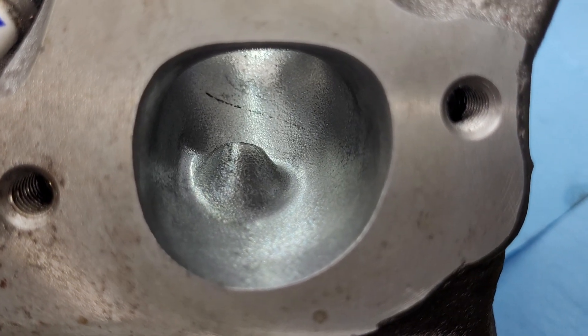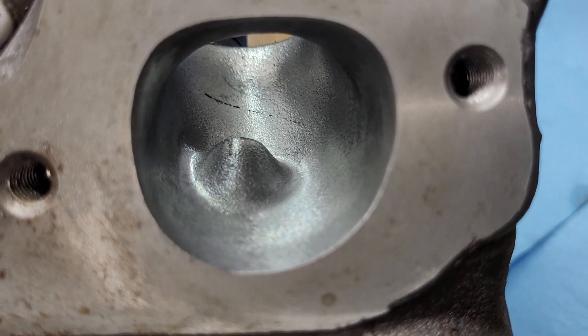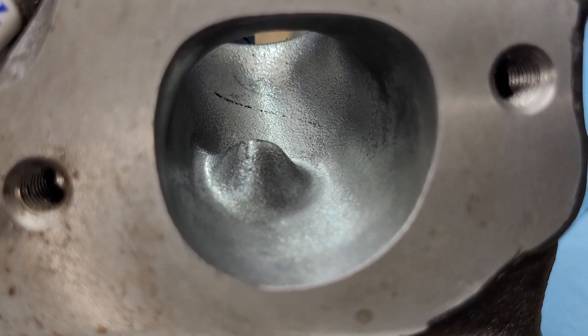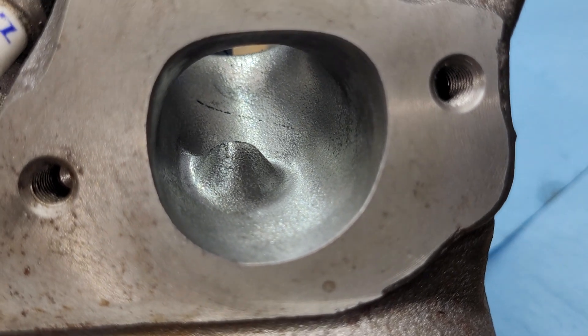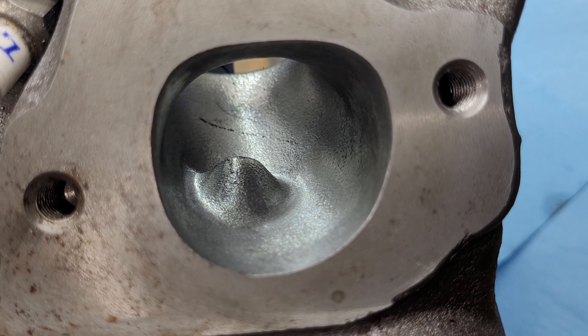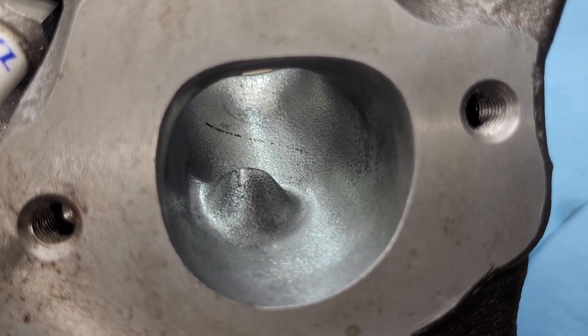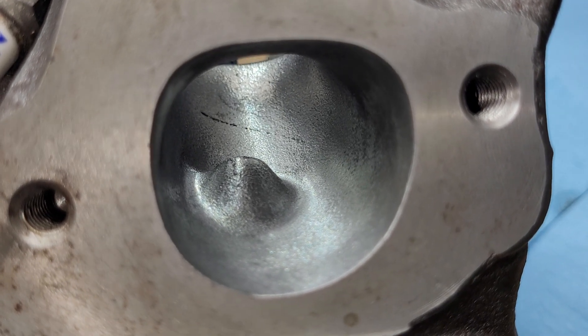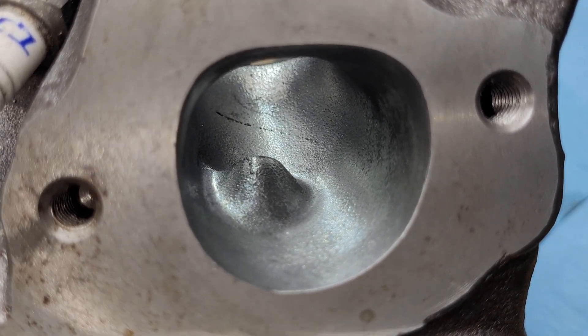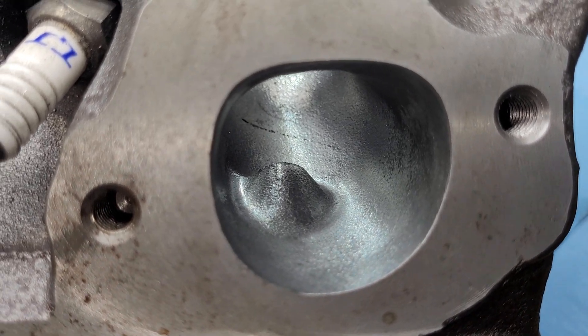I decided I'm going to give you a look at the exhaust port. You can see I still have a casting line all the way against the back of the bowl, so I haven't really made it that much bigger - but it does do quite well with a pipe. It's pretty good in the mid range; I do have to work on the high lift flows a little more. We're going to take that under advisement. Alright guys, thanks a lot - have a good night.